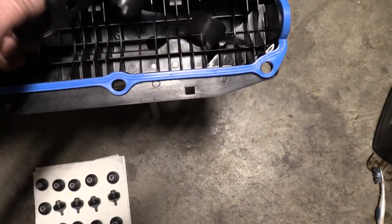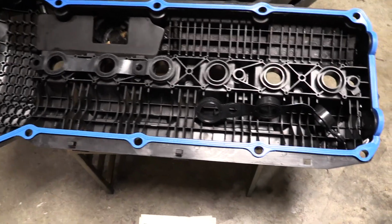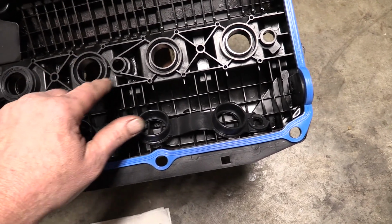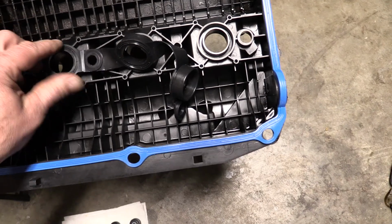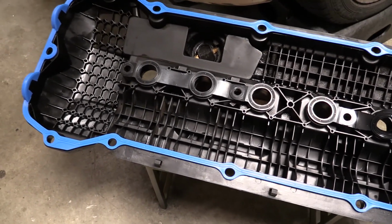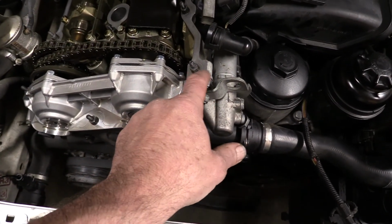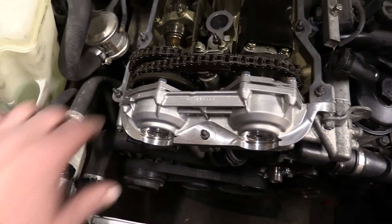But these, I did the shake test. I turned it upside down. Sometimes the gaskets will fall down on you trying to install them. So I did the shake test. These fall out. So you put another drop or two here, not a lot. You want to use it very sparingly, but it'll help keep them from falling out as you install it. I also like to put a little bit of RTV right here, right where the joint comes together, and here, right across the top there.